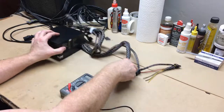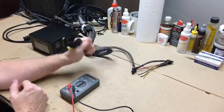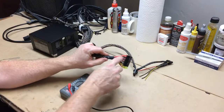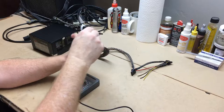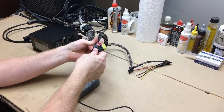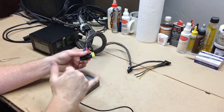I've got a couple of things here on the bench that you're going to need. I'm going to overlay a picture of the layouts. This is the part of the power supply that plugs into the computer motherboard — this one happens to be a 24-pin. It's an older one so it has colored wires. A lot of newer ones are shrink-wrapped all the way into the connector, but the pinouts are the same. I'll overlay a shot of the pinout diagram. Some really old power supplies are only 20-pin, but the process is the same.